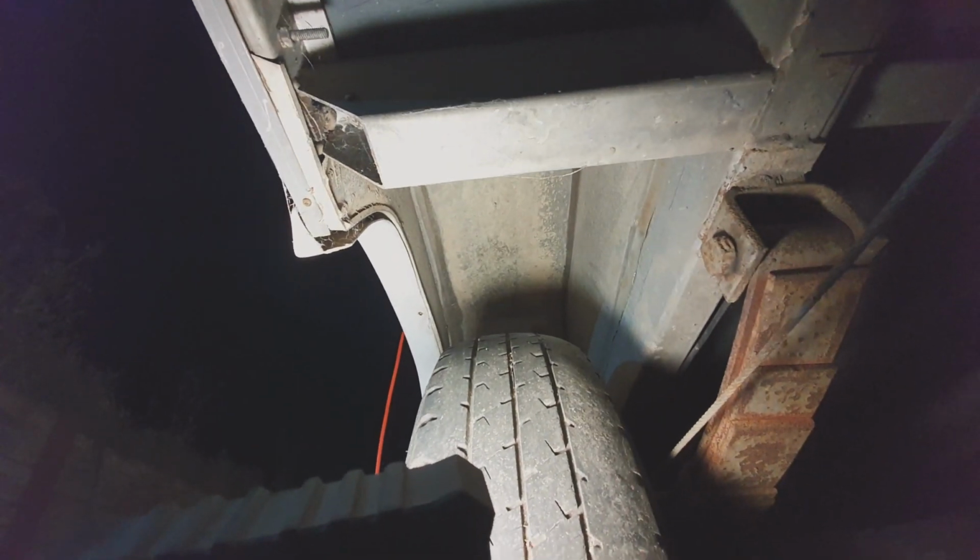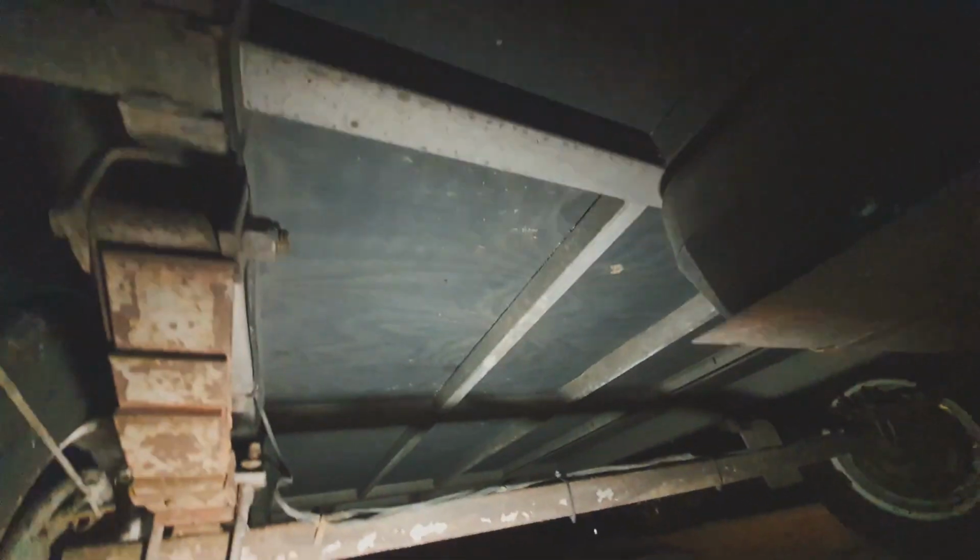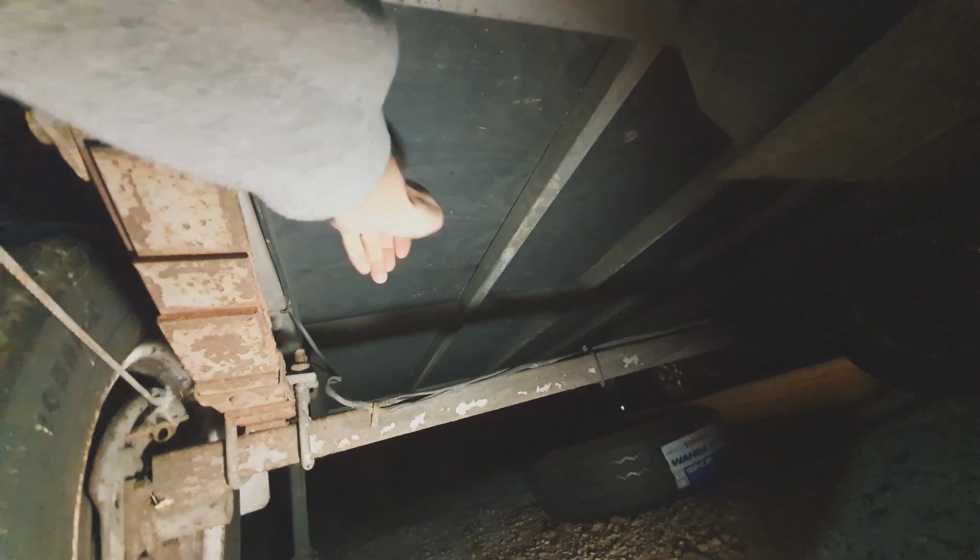That's the wheel well, where that was the carpet area inside, and then this is the floor beside it, just inside the box. And directly above the axle, there's just space for days, but if you come further forward or back, you hit these cross members. So I'm just going to bring it out here in the box. I think the hole will be just there. And then the exhaust can just run sideways or backwards. So that should be a pretty neat spot. The fuel line can come down along the rail then and back to the front.